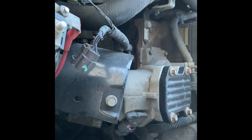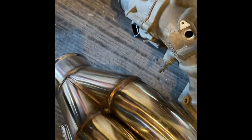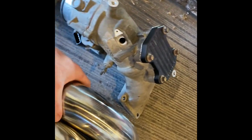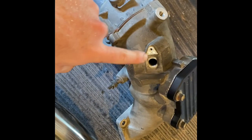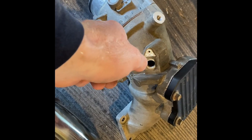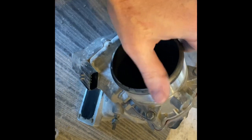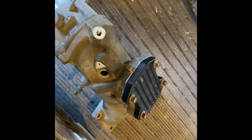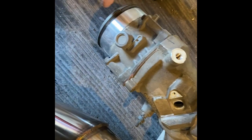I had to start recording in the garage — I took the MAP sensor out, which goes here and it's going to go right in the bottom. It's a Torx 15. What holds it is a little o-ring, so you kind of have to give a little bit of force to get it out. The plug will not go back in — that's what controls the butterfly inside. These bolts are all 10 millimeters, and there's another 10mm up top for the bracket.